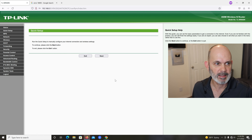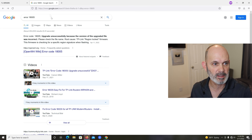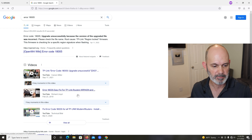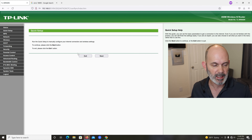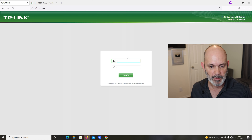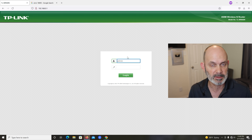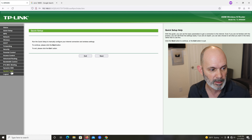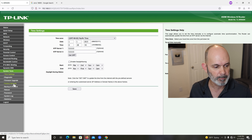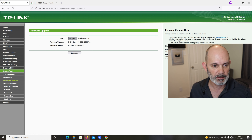I've done the instructions from that video to get rid of the 18005 error. If you want to see it, do a Google search for 'error 18005' and you'll find my video — 'Richard Lloyd easy fix for 18005.' Most likely you won't have that problem on your router. Back inside here, it's going to try a quick setup — just hit Exit. Hit admin again, the default credentials are admin/admin for TP-Link. We're going to go to System Tools, then Firmware Upgrade and try this one more time.